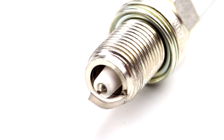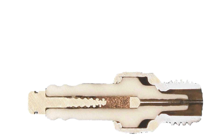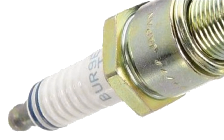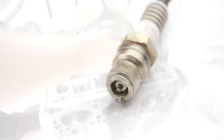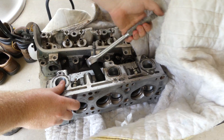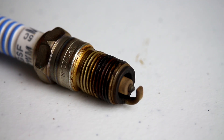Spark plug heat range. This refers to the speed that a spark plug can transfer heat to the engine's cylinder head. The heat range is determined by how deep the gap between the insulation and the metal shell goes, and this is usually put into a manufacturer-specific code printed on the plug. The deeper it gets, the hotter the plug is considered. A hot plug retains more heat, while a cold plug disperses the heat more quickly. If you install a spark plug that is too hot, it can cause pre-ignition, which can lead to engine damage. Using a spark plug that is too cold can cause the plug to foul out because deposits will build up on it.